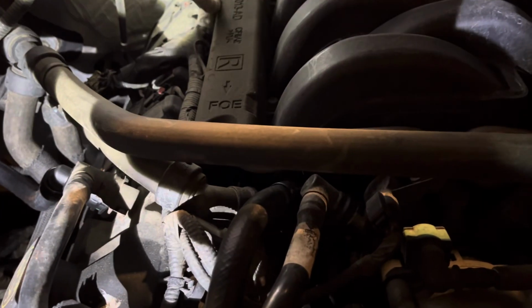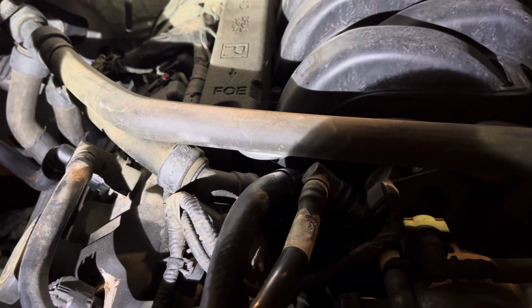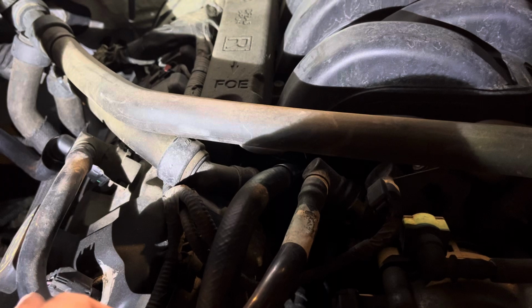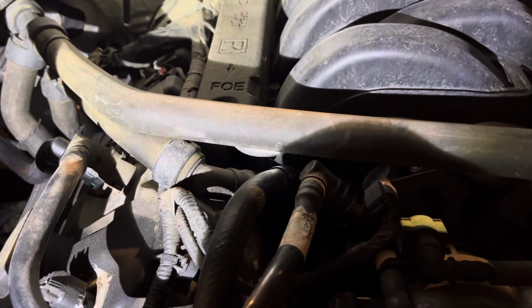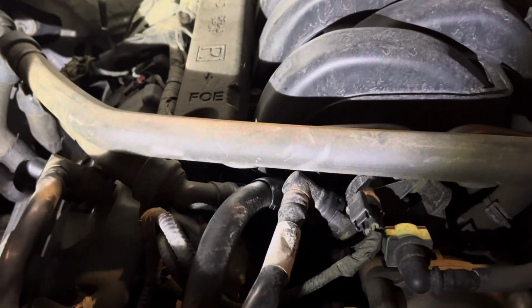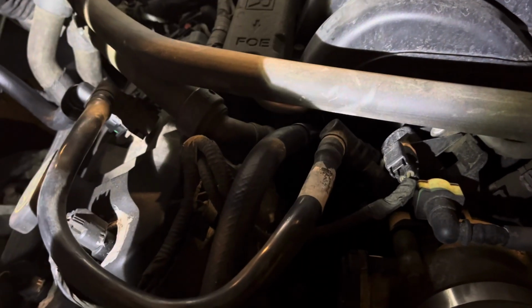So oil vapor, as well as oil, is what I'm finding out, goes in through your normal combustion process through your intake manifold. So really, I think what folks are seeing is reduced fuel economy, probably power as well, as you're essentially diluting the actual fuel octane or the actual combustion process with the oil basically circulating back in through the combustion instead of draining elsewhere. So I'm thinking they do this probably for environmental reasons. But anyways, we're here to talk about the J&L catch can here.